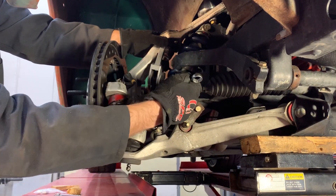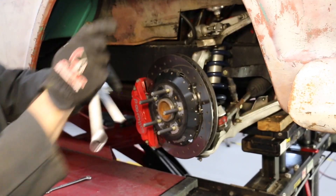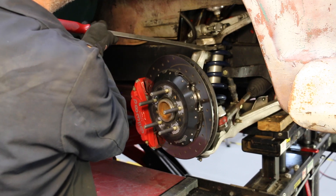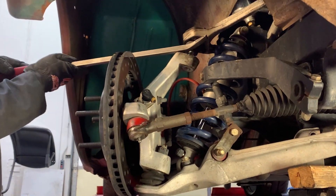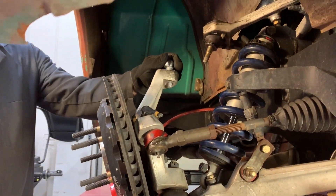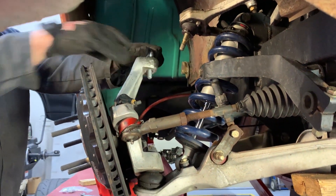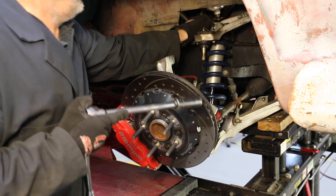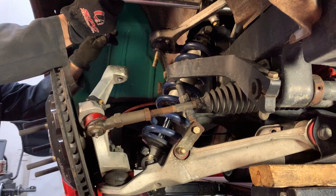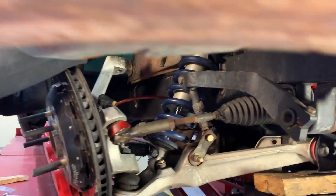In this case, the outer two ball joint retaining bolts required removal for puller jaw engagement. If this is a custom installation with a potentially unknown knuckle, test fit the ball joint post in the knuckle taper. A component ball joint post is being tested here. The ball joint post must fit correctly in the knuckle with no rocking due to different taper angles. Not all knuckles, even from the same carmaker, had the same angle or dimensions. This one fits well with no rocking.